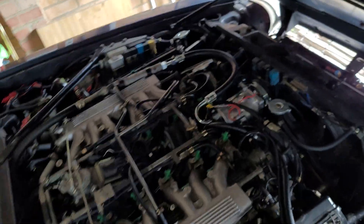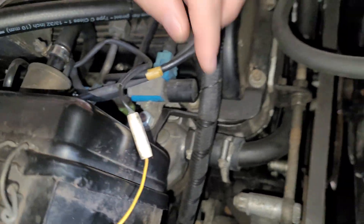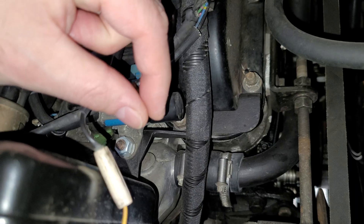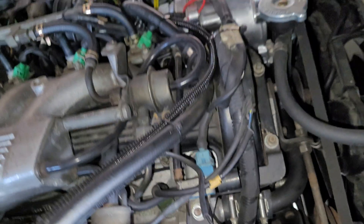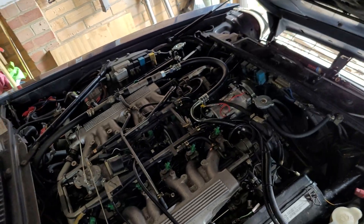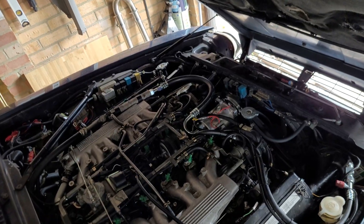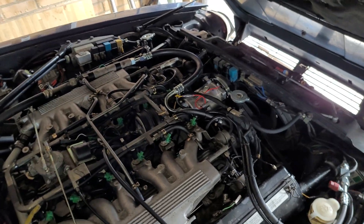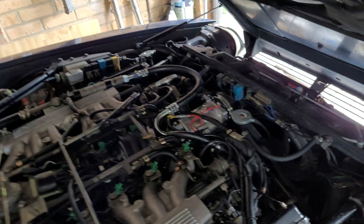Another point is the thermostats, which sit in housings with one on each bank of the engine. You need to make sure you use the correct type, specifically the correct length. When the engine is cold the thermostat is closed, blocking flow to the radiator. When it opens, its length causes a disc on the reverse side to block off the bypass pipe port back to the water pump. So use thermostats with that disc installed and of the correct size — there are forum posts with pictures of people who have gotten this wrong.